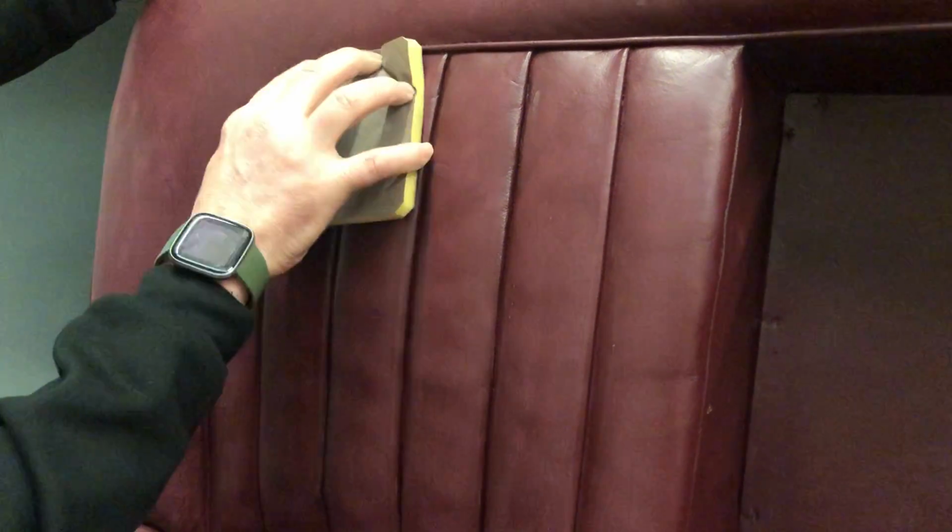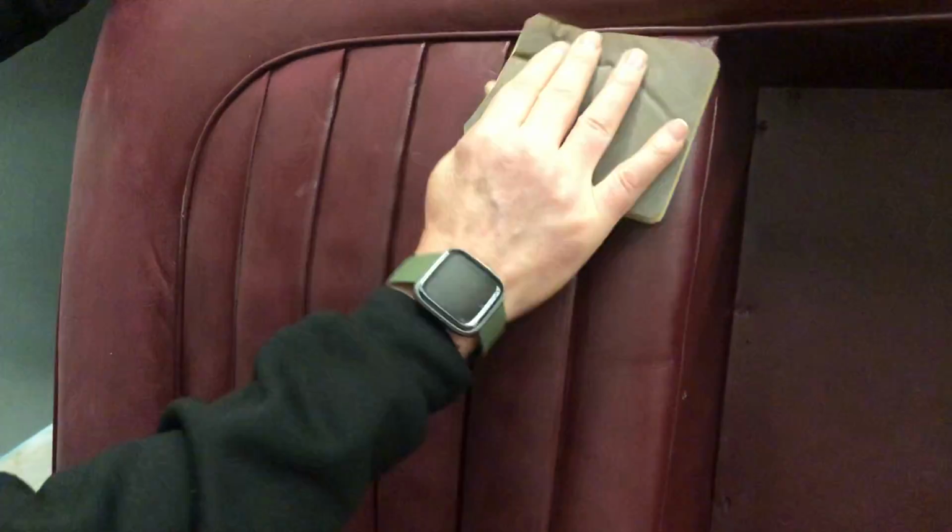We choose this type of sandpaper because it's quicker, because it's coarser, but because you're not putting the pressure on, you're not really doing any harm to it, and you're going over the surface really nicely and quickly. It's speeding up the process with it being a slightly more aggressive paper, and it's working absolutely fine. It doesn't matter which way you sand, the purpose is to denib it and make it feel nice again and make sure you've not got any high spots on the actual leather itself.